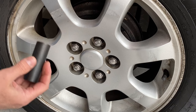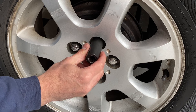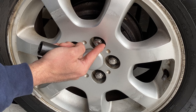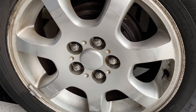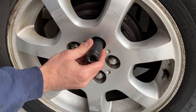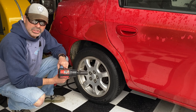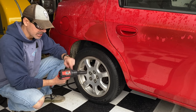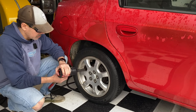It's also important that you get the exact size socket for that lug nut. You don't want something that's close enough but has a little bit of give, because if you're using an impact wrench or even a breaker bar, you could strip the actual pattern on the lug nut and then you've got a real problem. So make sure you get the exact size with a nice snug locking fit. What I have here is a pneumatic impact wrench — this is a pretty strong one, it has 1,200 foot-pounds of torque. We're going to see if that can break it loose. If it doesn't work, we'll move on to a breaker bar. Let's go ahead and give it a shot.